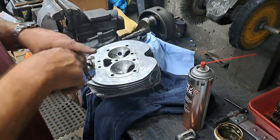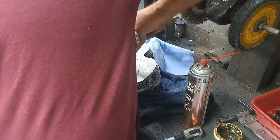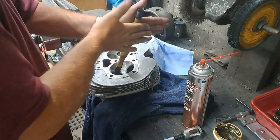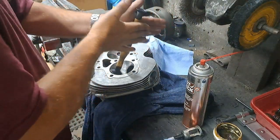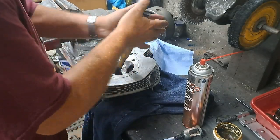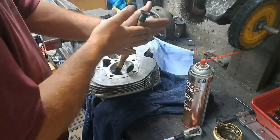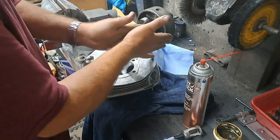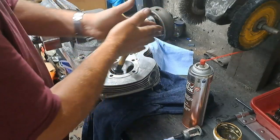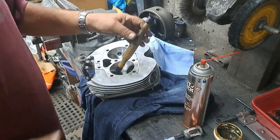And there, give that a little lick. Or spit on it. Or just put some water on it. Anyway, you hear that grinding sound? That's the actual lapping paste there, cutting into the valve seat and the valve face itself. So I'll just do this for, I don't know, 2-3 minutes. Make sure I've got a good seat. And I'll pull it out and have a look at it.